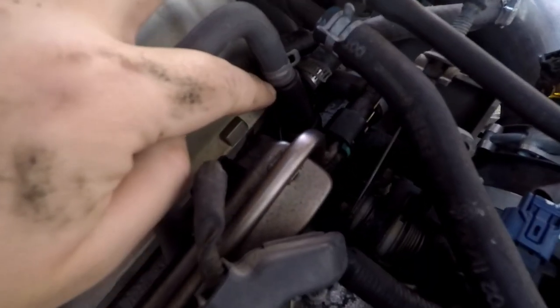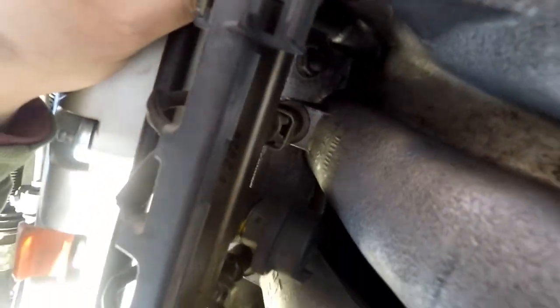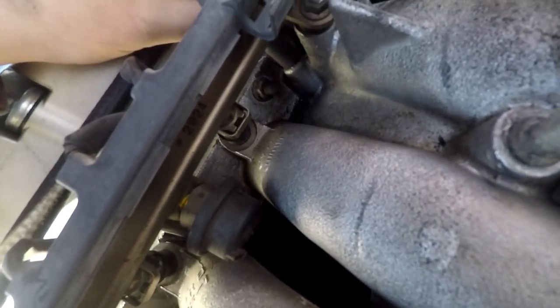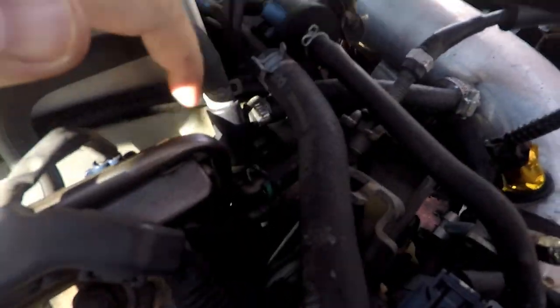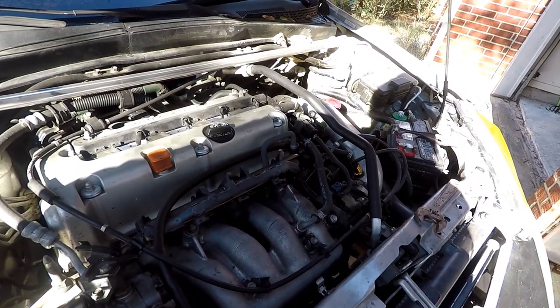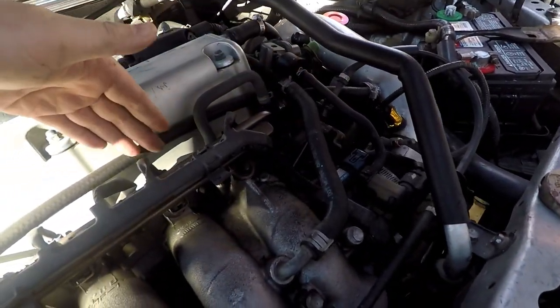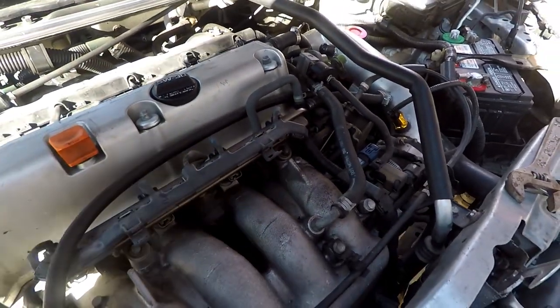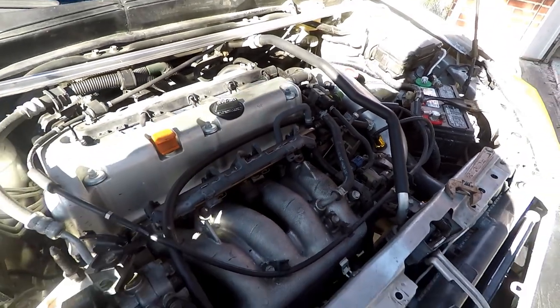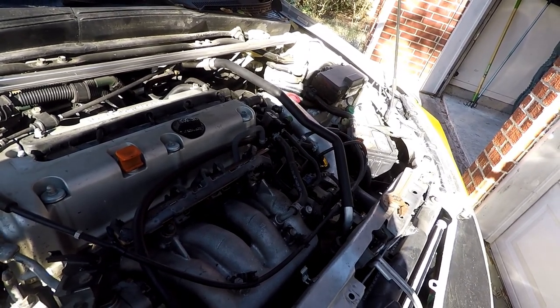Several days later - it is Friday and as you can see it's pretty sunny, still a little chilly but warmed up enough. So I'm gonna do that mod. Apparently it's called the idle air assist control valve - it's right here. There's a hose that connects to the intake right here and then a hose that goes to the intake manifold. What this thing does is when your engine is below a certain temperature it opens - so during cold starts it helps route air from the intake directly into the head, making your engine warm up faster.